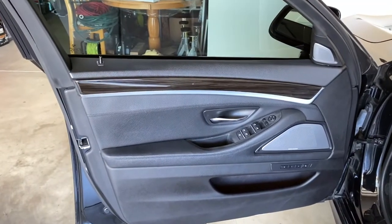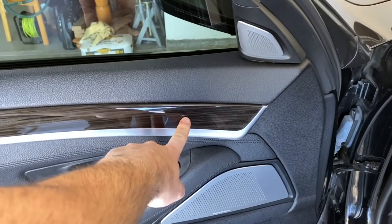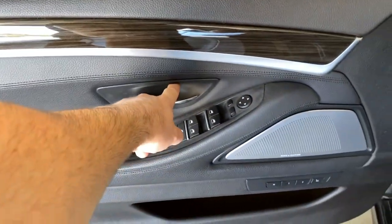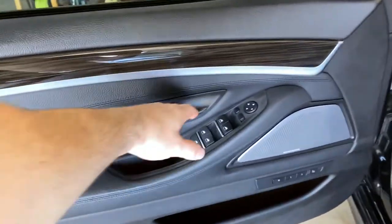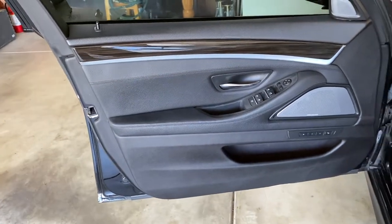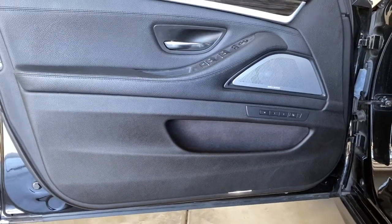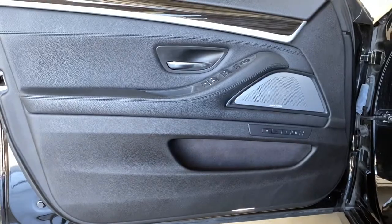For the front door I won't bore you with all the details, but you remove the trim from back here all the way out. You still have one of these metal brackets - push from the bottom to take it out. This time you also have to take it out because there's a screw behind here, and again one there - so two screws come out. Remove the ledge, there's a little white plastic piece you put in the back and take out. Unplug all the wires and the door panel is off. I've seen people not unplugging the wires but I'm not a fan - I'll take it off completely.